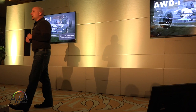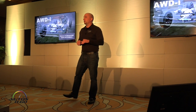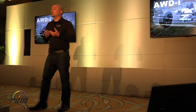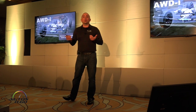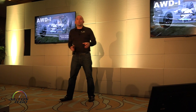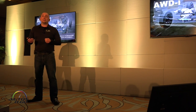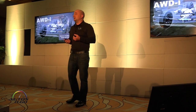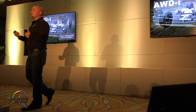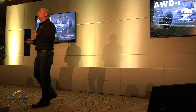AWDi, or All-Wheel Drive with Intelligence — all 2016 RAV4 hybrids come standard with AWDi; there are no front-wheel drive offerings. This is different from conventional all-wheel drive in that there's no mechanical connection between the front and rear wheels. Like our Highlander hybrid, there are two separate electric motors — one paired with the engine up front in the conventional hybrid system, and a separate motor in the back driving the rear wheels. That rear motor operates independently, giving you added power at the rear wheels during acceleration for better traction, and kicks in during cornering for better stability and the ability to trace the line better.